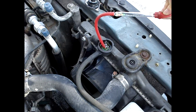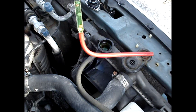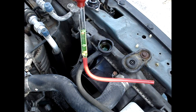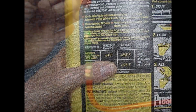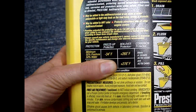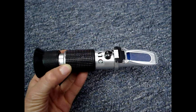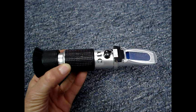I had always heard that hydrometers were not very accurate, so I was skeptical about the reading. I made a 50-50 mix of antifreeze and distilled water and tested it with a hydrometer, and I got the same result. My plain-jane green antifreeze with a 50-50 mix is supposed to test at negative 34 degrees Fahrenheit.